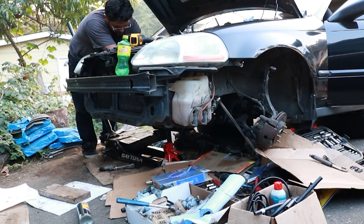Getting the tranny in was a real challenge for me — a lot of people probably won't run into this. There's also not much information out there on how to raise the tranny and insert it; they kind of just say jack it up and go. For a first-time builder it was a pain. These two top screws were clogged in the threading so I had to chase them with a thread chaser — after installing it twice already. On the third attempt I finally got it. The back T-bracket was also hanging me up quite a bit. I got the linkage going.